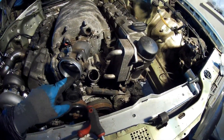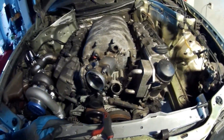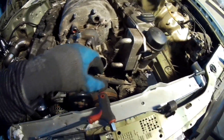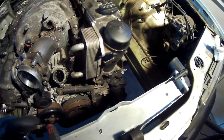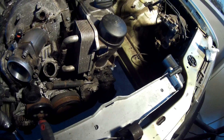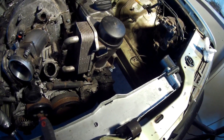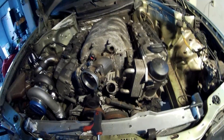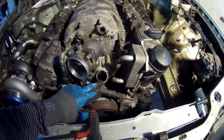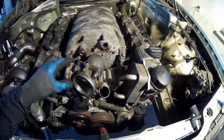Then I'm going to do something with the throttle body, because if the cooling pipe is in front of the radiator it will heat up by the air going through. The best is to have it as high as possible and then go straight down. I can make something in between so it's not heating up by the air coming through the cooler. If you've got 90 degrees of water in the cooler, you get about a 10 degree drop from air - so it's like 80 degrees of air flowing over a pipe that needs to be cooled down. That's not ideal, so I'm going to fix this first, probably with a hose. This bit is fixed and I think it worked out pretty good.